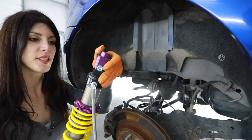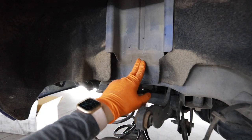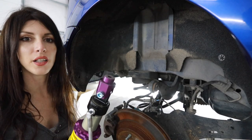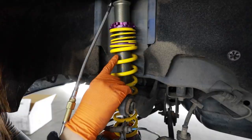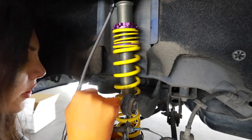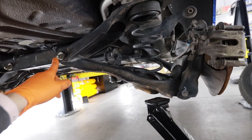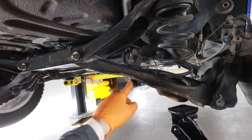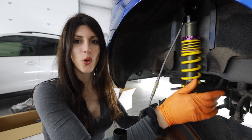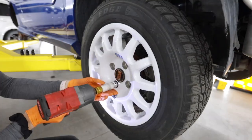They designed the top half of this coilover to be flexible so you can actually move it in or out. Something the engineer told me I'd probably have to do is behind where the strut mounts — which is going to be kind of difficult because this is where the frame rail is pinch welded to the back piece of shell — that has to get bashed in a little bit, maybe 10 to 15 millimeters, so it'll clear the coilover. As for the bottom, I'm ditching this spring, so I'm thinking this lower piece should just be replaced with a straight rod that has heim joints on either side. I just don't know how the rear anti-sway bar would attach in that instance, and this upper control arm is going to have to get re-engineered.